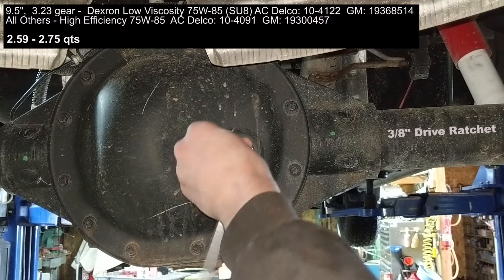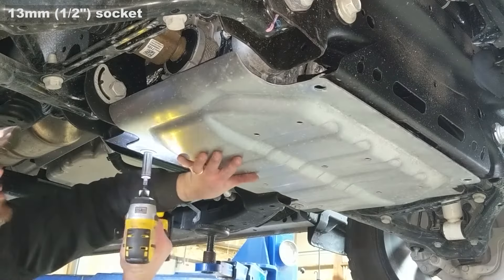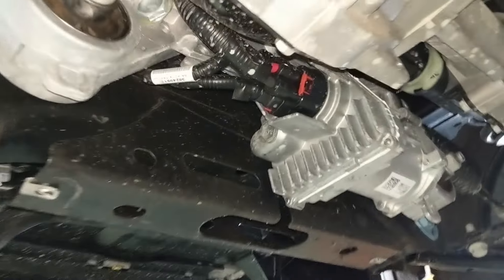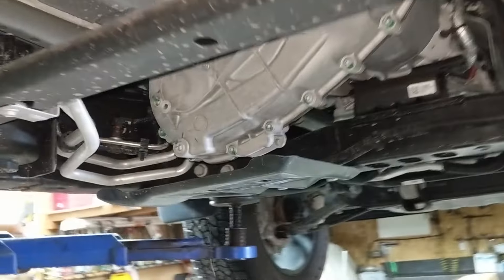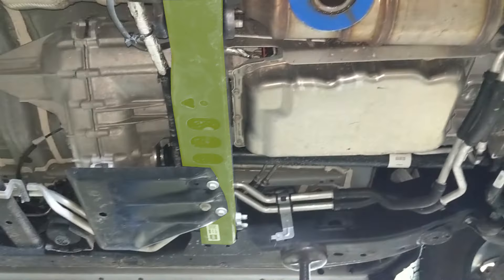The rear differential has some variations — you can look in the specs — but you've got to take off the rear pan to dump it, and then a 3/8-inch ratchet gives you access to fill it back up. Taking off the front plastic skid plate as well as the aluminum one lets us get a look at the front differential. That's not going to be serviced by pulling off the pan, so I'd use a top-sider or suction pump to pull the fluid out. Here's the electronic power steering rack by the front differential. The front driveshaft now has an axle instead of U-joints. The rear drive shaft is still the same. Here's the fuel filter — it's the same assembly they use on the Duramax 6.6.